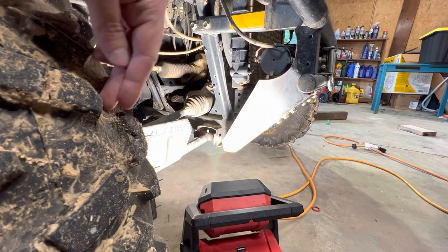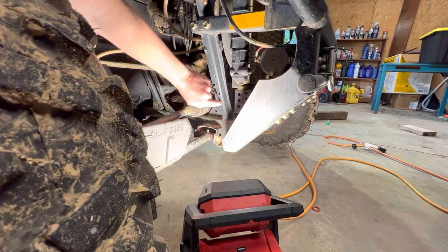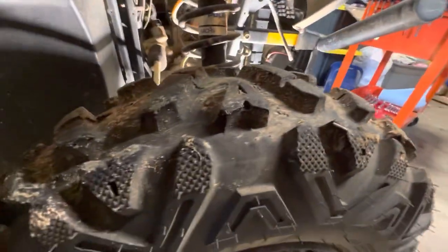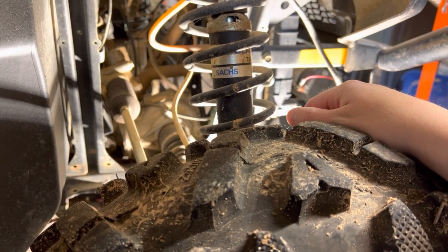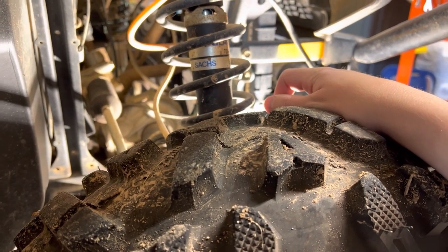This right here is the front passenger tire, and this is the shaft that goes into the front gearbox. The oil fill plug is located right behind this bracket here — it's part of the frame. It's a bit hard to see, but there it is — that's the fill plug. I always recommend taking out the fill plug first, because if you take out the drain plug and for some reason you can't get the fill plug undone — whether it's really on there or you strip the bolt — well then you've drained it and you can't do anything.